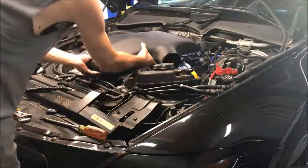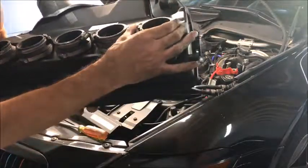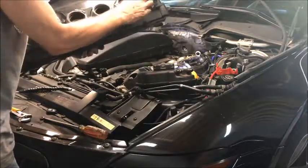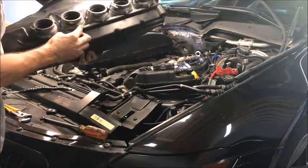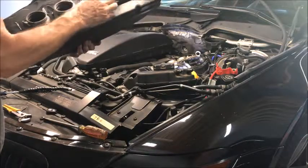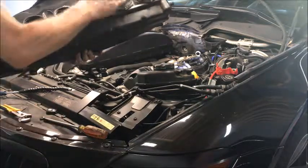Pull the plenum up — and voila! There are all those little things you were dealing with. Each one has a little stopper to orient it in the right direction. So if you take these boots off, make sure you put them back with the tabs lined up — each tab — because each one has an orientation that helps you get these little seals properly aligned.